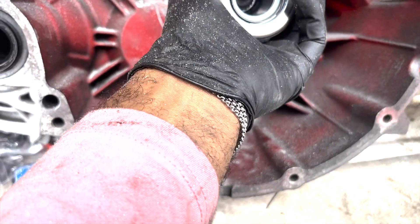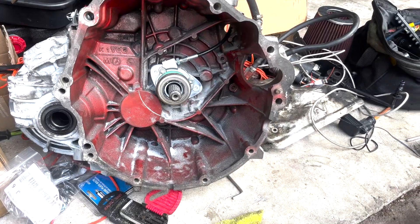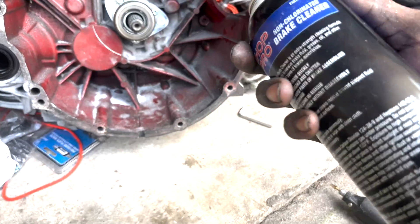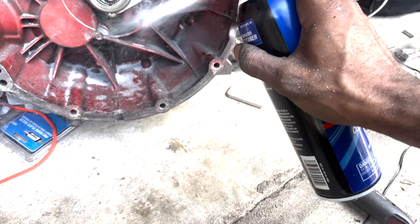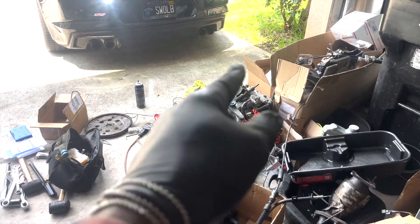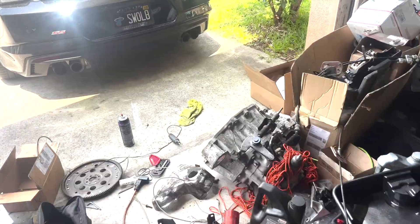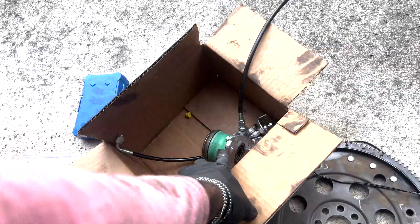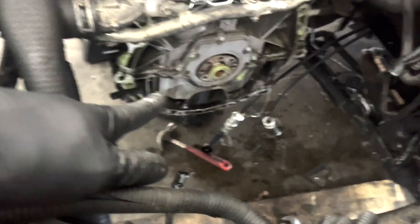I'm going to go for my first initial test fitting with the upgraded slave. It pretty much comes through right here — it's going to sit flush, and it does look like it'll clear everything. I'm going to owe Corey and everybody here some money because I've been using their brake cleaner. I found it in the garage — hit the disc with some brake cleaner to get all that dust out. I test-fitted the upgraded slave on the transmission and then removed it and put it back in the box because I need to clean the interior of the transmission really well — all the metal shavings could potentially rip the seals. So we're not going to mess around with that. I'm going back to the car now to install the flywheel, the clutch, and the pressure plate.